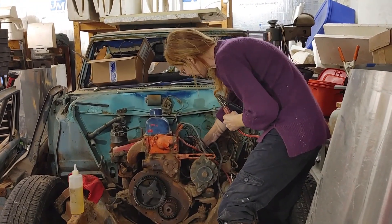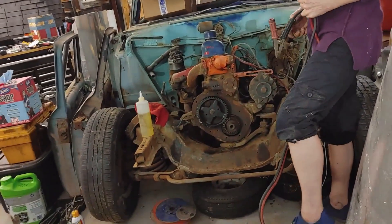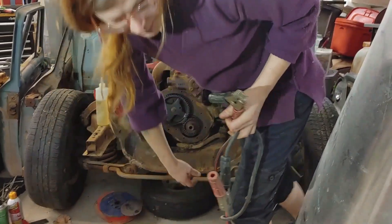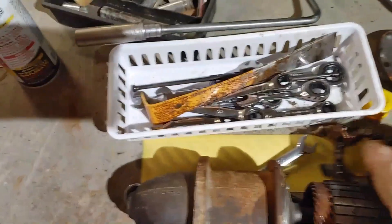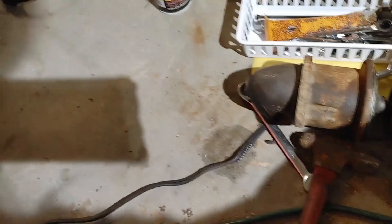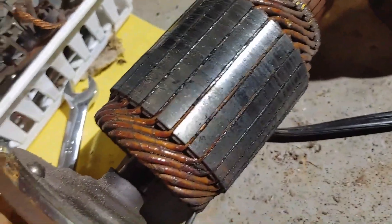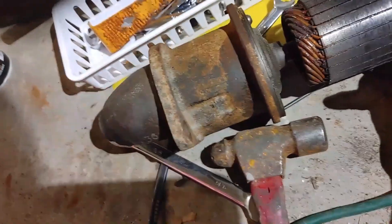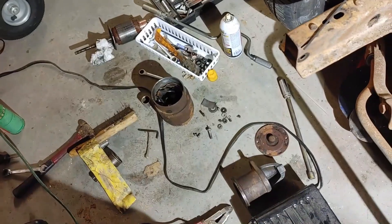What's the timing? Or we're not even getting to that — I think it's your compression. You've got big long cables and a dubious battery. I've got this thing on too much. Well, we got our starter apart and the brushes are worn down a bit, but I think there's enough to still make that work. It's kind of dirty though, kind of icky. I'm going to clean it up and give it another try. It doesn't look like anything's obviously completely cooked, but it does look like there was some contact happening, and that's no good. We'll go back together as soon as we find a washer.